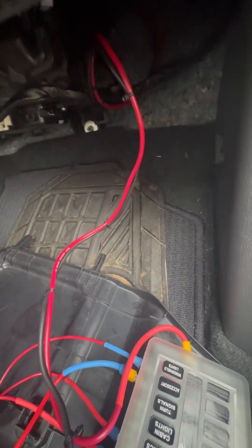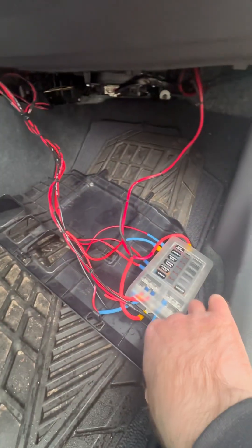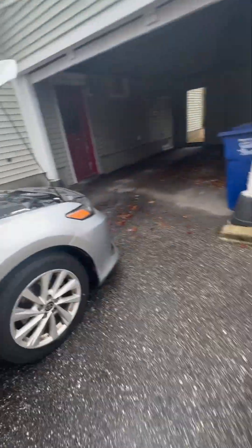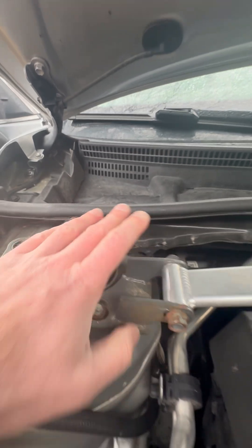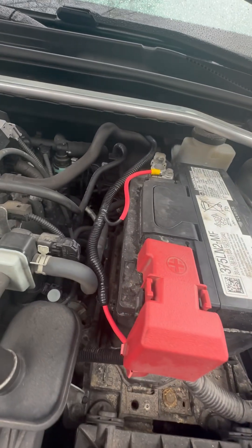We come in through one of the wiring harness gaskets, and then I augment my passenger side under-dash cover. The gasket is behind the windshield wiper cover, so you just take your windshield wipers off and uninstall the strut tower bar, and then you can get to the gasket.